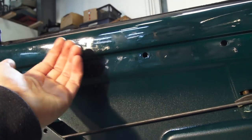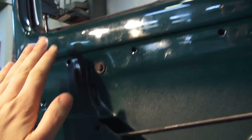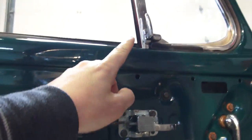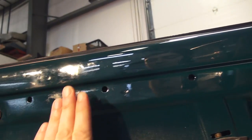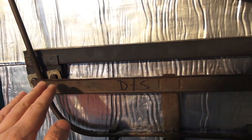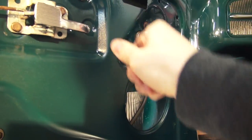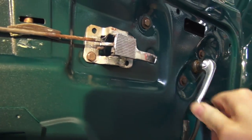Get the glass on the right angle and up into place, then bolt it to the mechanism. Often I go up with the window first to get it clear of the scraper area, since the window can catch on inner or outer door parts. Going up first sets you up so the felts and the vent post felt are in line. Then come back down, bolt it loosely here and here — leave them loose for slight adjustments. Test the window with the window winder; it should go up and down freely with ease.